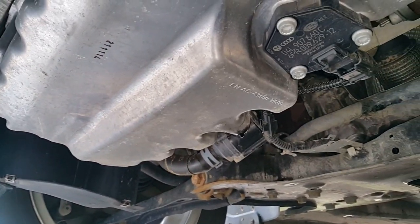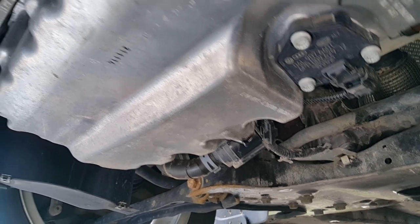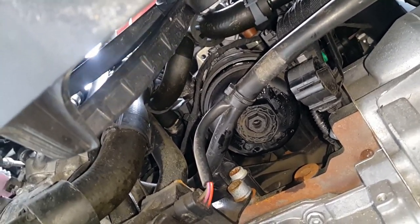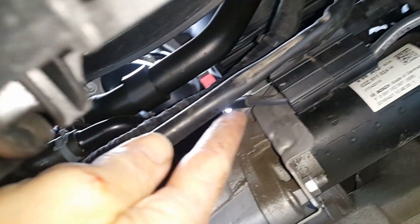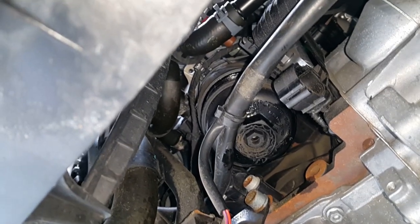The drain plug is easy to get at — just a standard drain plug. I've already unscrewed the oil filter most of the way so the excess oil drains off. You've got to unclip this wire cable back here — there's a clip, you just unclip it off these clips and pull the cable back a bit. It's dead easy to get at the oil filter.